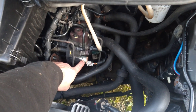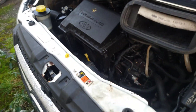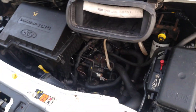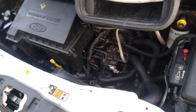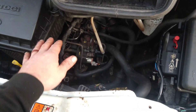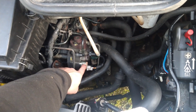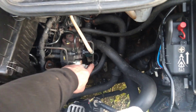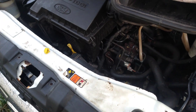I've waited until the next day so I could see what I'm doing and replace this fuel metering solenoid. I'm going to recheck it, but already it sounds much better. I haven't coded it to the car just yet — that does make a difference though, so I need to do that still. But it's not surging, it's not going up and down in the revs, so that seems to have fixed it on its own so far. I could connect up a scope and see what the difference looks like on the waveform.